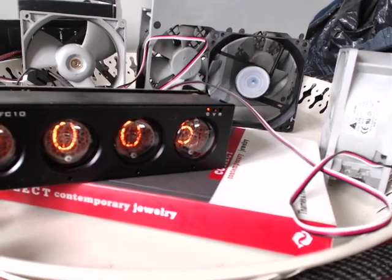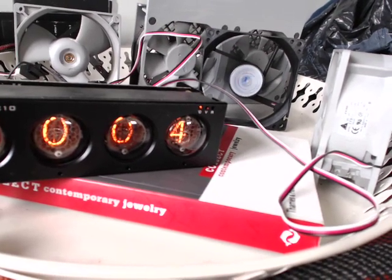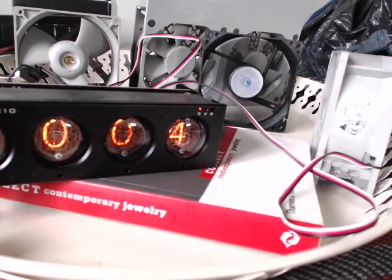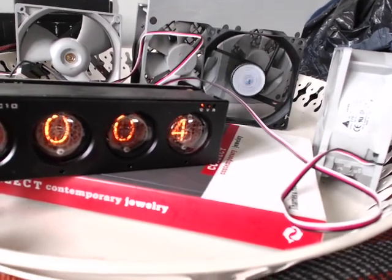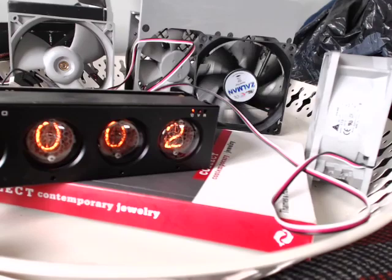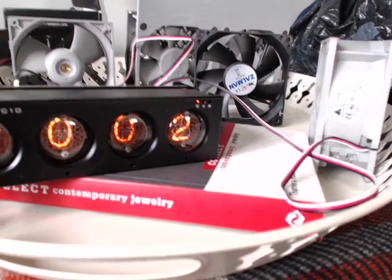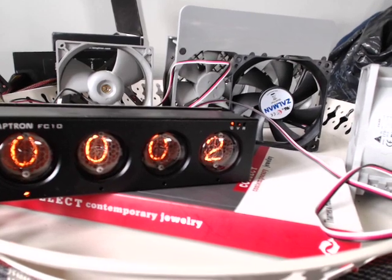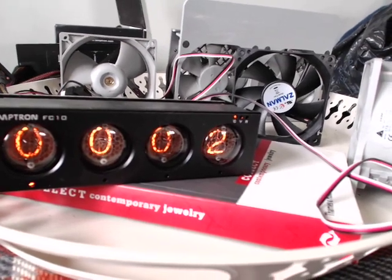Now a lot of people say that the G5 fans are inherently noisy, and it's a problem with the fact that PCs can't push the motors properly the way that the G5 motherboard can. There's all sorts of different theories around this, but as you can see, if you stick the internals of a typical PC fan into a G5 housing, there are benefits. The benefits to that is that you can then just hook them up to an ordinary motherboard and an ordinary fan controller, and you can set them according to the noise level that you want, or you can use a noise reducing resistor.